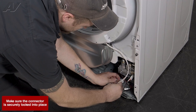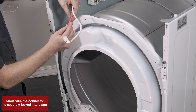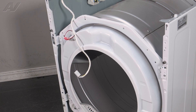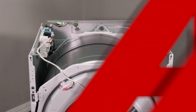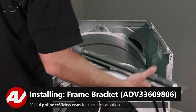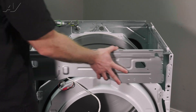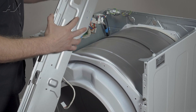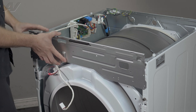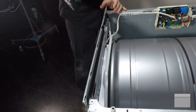Plug back in our wiring harness on the bottom. Let's move up to the top — reinstall our LED wiring harness as well as our strain reliever. Now we can reinstall the frame bracket. When reinstalling your frame bracket, you have two teeth, one on each side, that will slide into this area on the actual frame itself. Let's start on one side — make sure they're not bent, put it in, slide it down. Let's go to the other side — put it in, slide it down. We will reinstall our two screws. The metal likes to flex on this, so just be kind of gentle.